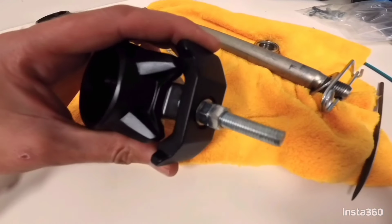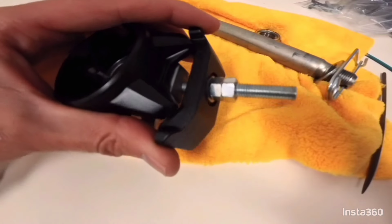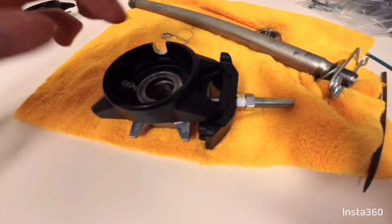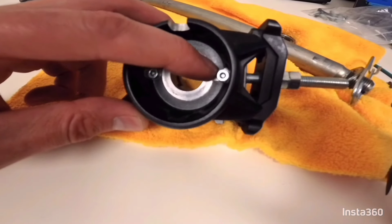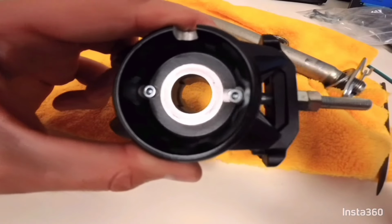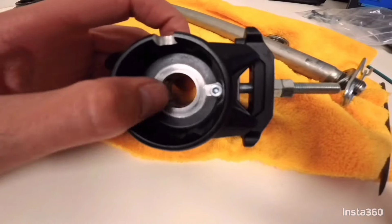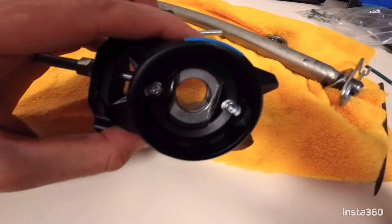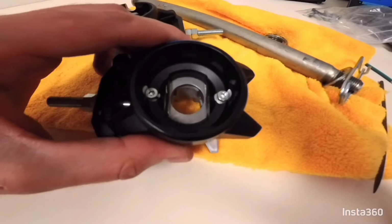Again, the idea will be that this end piece also gets secured in a fashion somehow, and I've not figured it quite out yet. But that's going to keep the adjusters and this aluminium part held into the swing arm in a certain location. And then these screws in here will not be tight. By that I mean they'll be loctited into the aluminium behind, but they won't compress these two pieces together, because it needs to slide up and down whenever I do a chain adjustment with the screw here. So it's going to hold the thing in place, but not actually compress the two together, if you get what I mean. And so that's hopefully going to enable quick wheel changes and not have me faffing around trying to hold all these things in place. I can just slot the axle straight back through and not have to worry about the positions of everything.